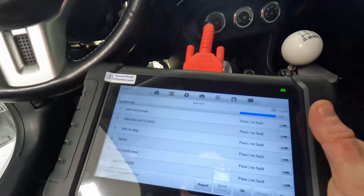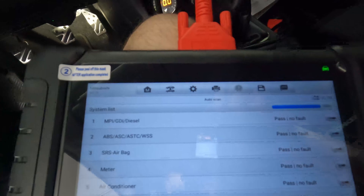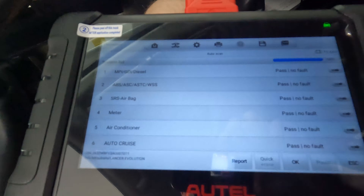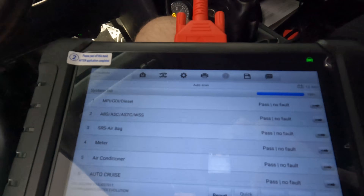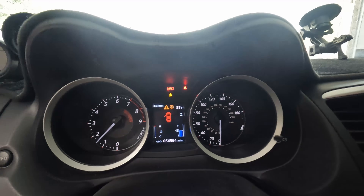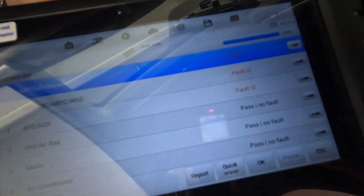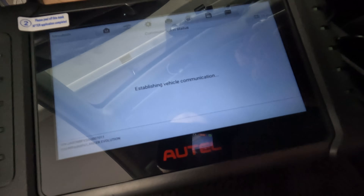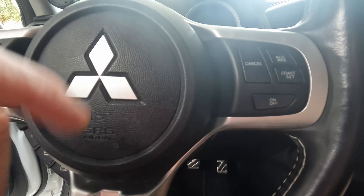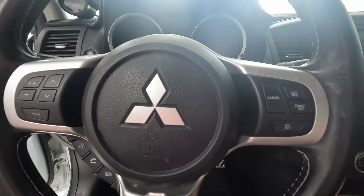So far so good. Everything worked out perfectly. I went back in and recalibrated the steering angle sensor — no issues, it said completed. As soon as it was done, the ABS light actually went off. After it didn't complete the calibration the first time, the ABS light had popped on also, so I was getting the trifecta. The other code was the steering angle initialization. I had to go in and erase all the other codes, and then when I ran the next diagnostic, everything passes. However, I started the car back up and the ASC system service required is still popping up — I'm still getting the ASC and four-wheel drive codes. Clicking read codes now gives me 'internal steering angle sensor error.' Before I order one, I'm going to remove the steering wheel and make sure everything is connected correctly, just so I'm not ordering parts I don't need.